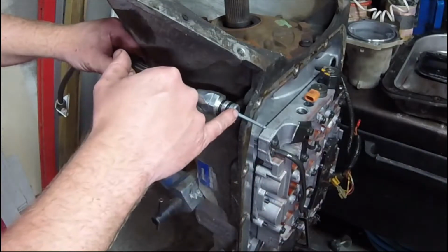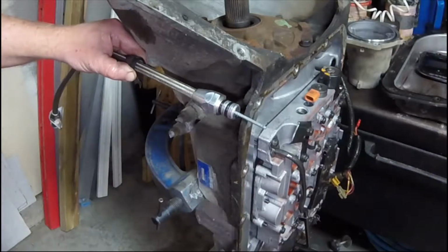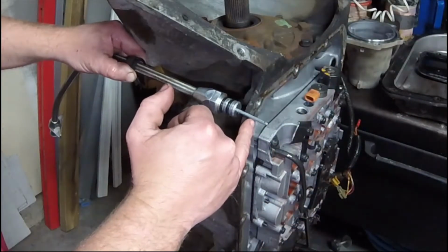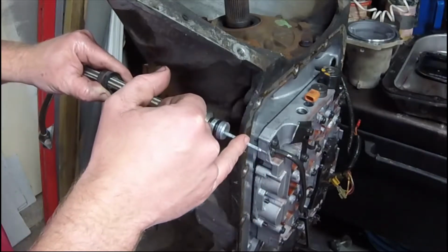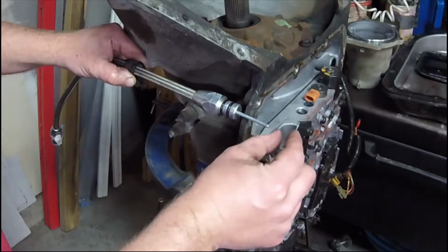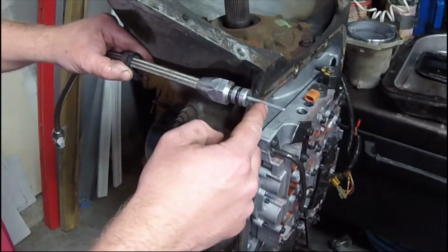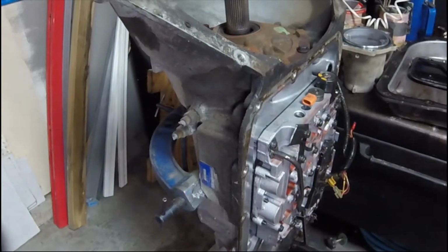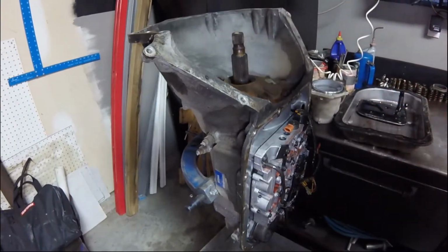If this is bottomed out all the way, it would have to be all the way up to the actual pan level to be considered full. I'm assuming that the normal level inside that pan is probably going to be slightly below that. But really, I could use this dipstick and just, if it's halfway up the marks, then I'm good. I bet the other one's just longer and it sticks out that extra, I don't know what that is, about half an inch or so down to there. So if I just took the half inch off there and went to the middle of that, I bet I'm perfectly fine. And if it starts slipping, I'll just add a little bit more. Remember, I'm cheap. Plus, that's like a $100 dipstick if I don't reuse it.